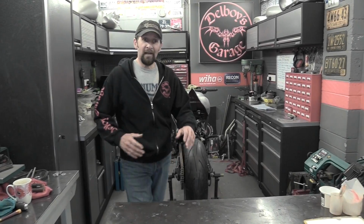Hi there, welcome back. Okay, for Sunday's video this week, I thought I'd do something a little bit different, have a bit of fun. Now, we all know, don't we, that you can use the sanding residue from sanding down filler, the stuff that gets all over your bench, all over the floor. If you collect it up and keep it clean and pure, you can recycle it by mixing it with resin and some hardener, and you can make more body filler from it. Done that loads of times. Also with sanding down fiberglass, because you're simply reconstituting the rubbing down dust.